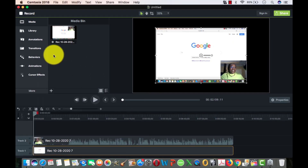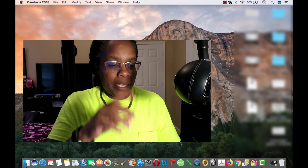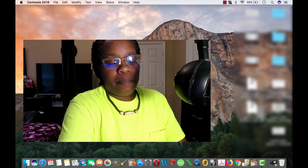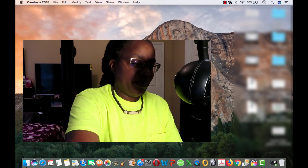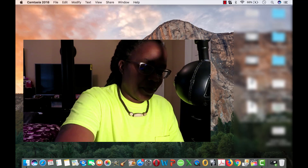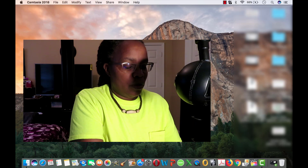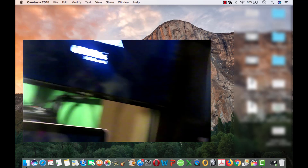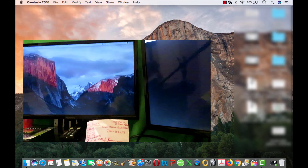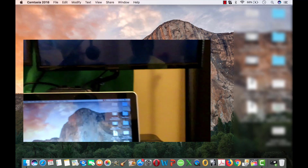Once that's done, click Restart. After the restart, make sure you plug up the cords — plug in the USB and HDMI cords into each monitor slot. Once you plug them in, it should automatically come up. One monitor came on but the other did not, so let's go into Display settings.